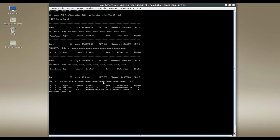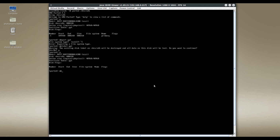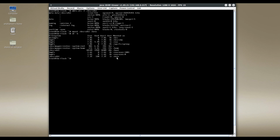The hard drive is connected to it, and let's now go ahead and take a look at it from a partition table standpoint. And once again, let's recreate the GPT label. Oh, sorry, that's not what I wanted. mklabel gpt. Okay, and then we're going to recreate the partition from 0% to 100%, and once again it shows up as 8 terabytes. Alright, let's go ahead and recreate the file system again across the entire drive, and let's go ahead and mount that. Okay, and df shows us /data, dev SDB1, that's that 4KN Hitachi drive, is showing us 7.3 terabytes, so basically the 8 terabyte drive.